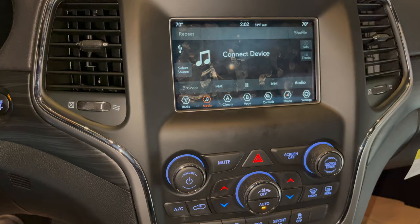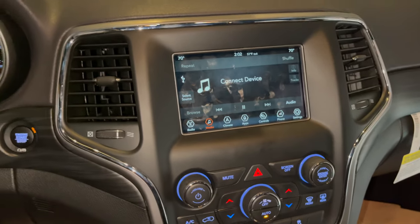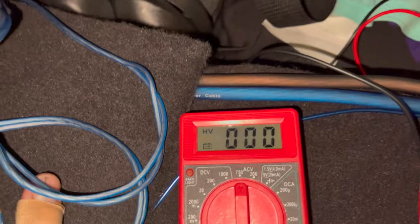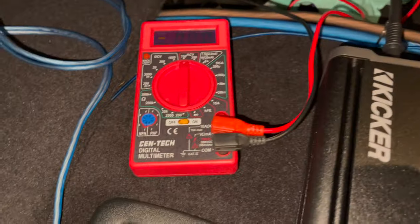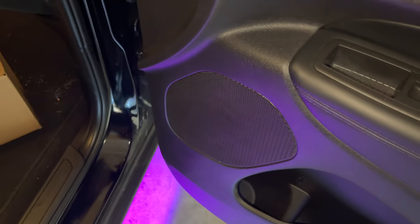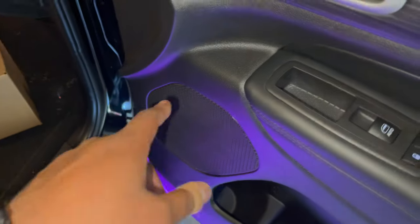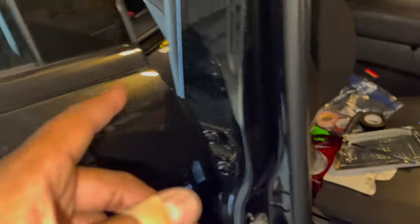For the next step, play your zero-decibel sine wave. Since I'm playing it off my phone I won't be able to record the gain matching, but what you do is: figure out your target output voltage, turn the volume up to that clipping point, and slowly turn the gain up until you hit that voltage on the multimeter, then stop immediately. You actually want to disconnect your front speakers first — this noise can destroy them. I got lazy and didn't do that, but that's how you're supposed to do it. The noise that comes out is unbearable, so set that gain quickly and turn it down immediately. Gain is set, everything's back together — let's go for a drive.